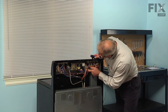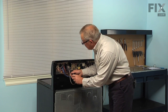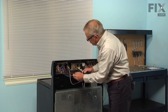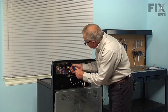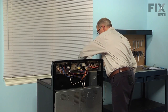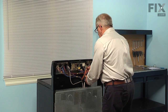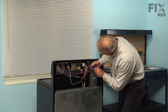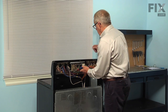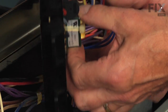Next, we have four more quarter-inch hex head screws that hold that control board assembly to the console, so we'll remove those. Then we can lift that assembly clear of the range.